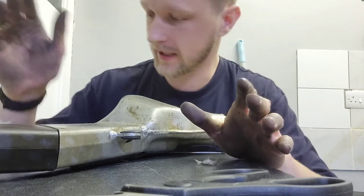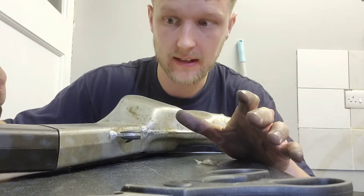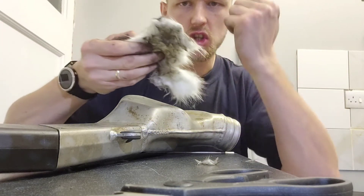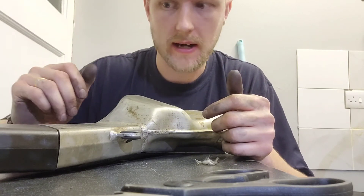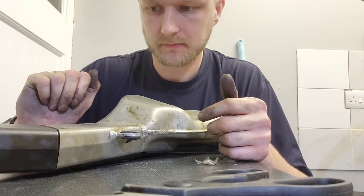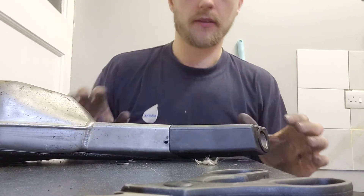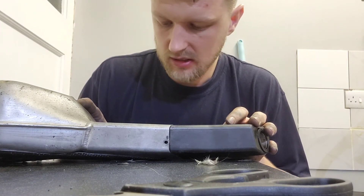All done, a bit tricky. I cut some off the end — you don't need to use as much as you think. It's a very tight spot on these Betas. In the end, rather than wrapping it, it was a case of lining it up as best as possible and simply stuffing it in with a screwdriver around the edges to make it nice, tight and compact — more than enough to do the job. On these rectangle-shaped silencers, wrapping is a bad idea.